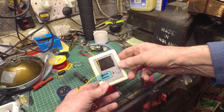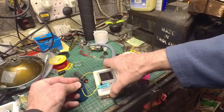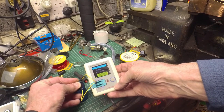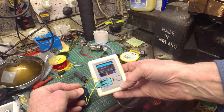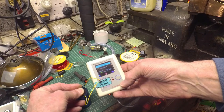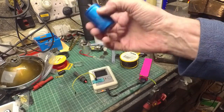I'll just try it with something else. This is the other gadget I've got for testing things like this. Let's give that a try. There you go — 5500. V loss 2.2%. ESR 0.33 ohms. So yeah, that's OK.